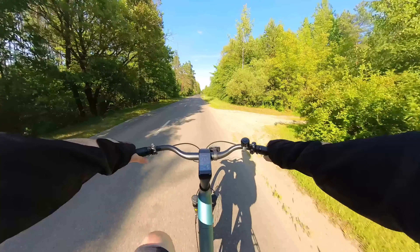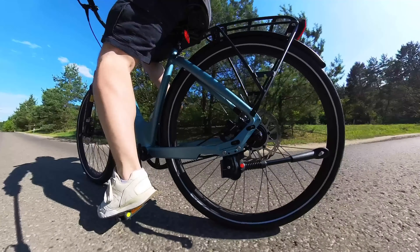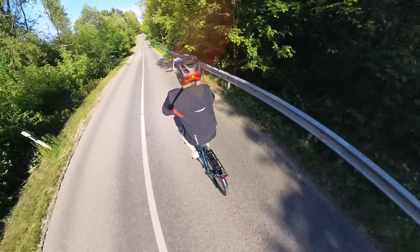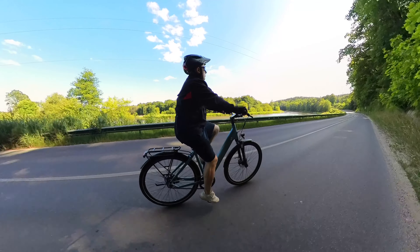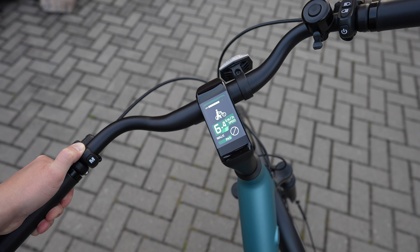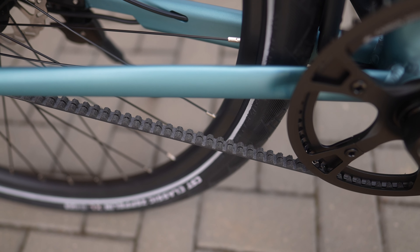First of all, let's talk about the key specs and features. The bike is powered by a 250W rear hub motor based on a 36V system. The speed is limited to 25km/h, and a 374Wh, 10.4Ah battery assures up to 100km range on a single charge. The Seago 800S is designed to be road legal in the EU and complies with all requirements. There is no throttle, but if you press and hold the arrow-down key you will enter a walking mode limited to about 6km/h.